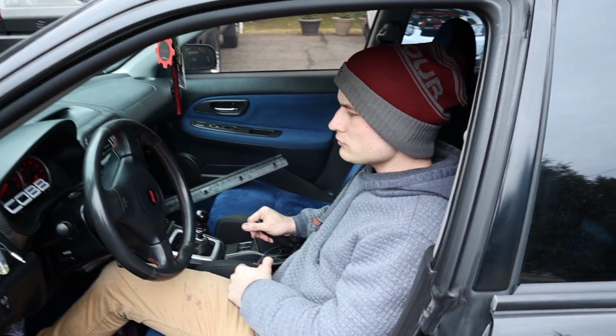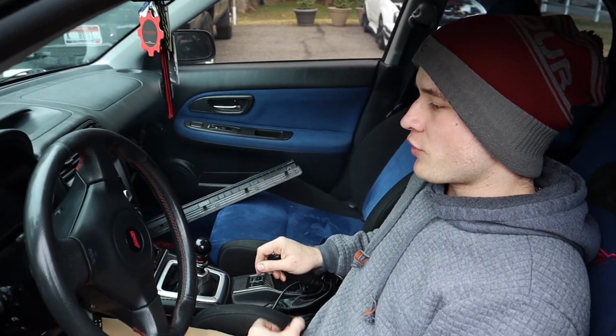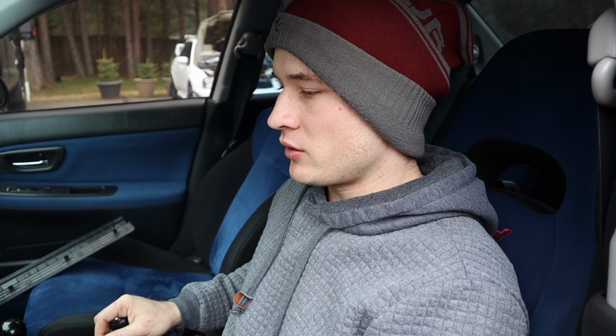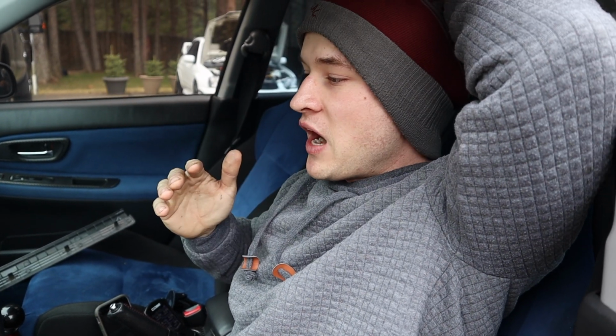No mid-pipe. All right. The ECU is relearning itself right now, just because of the engine overhaul, relearning the air to fuel and stuff. So we're just waiting for the coolant temp to rise to 190, 195, and then I'm going to take it around for a cruise around the block, and we'll see if it breaks.